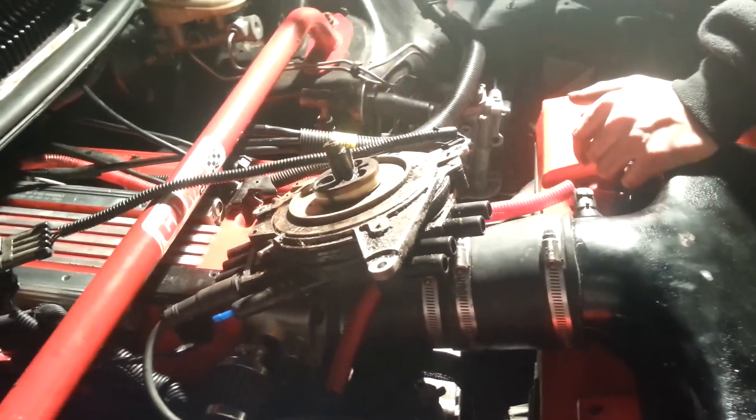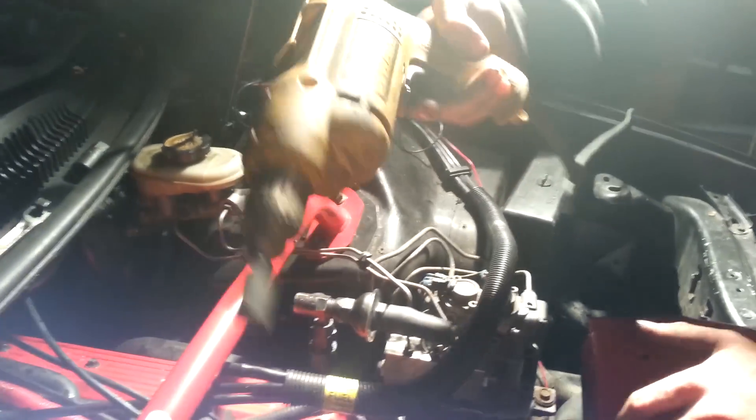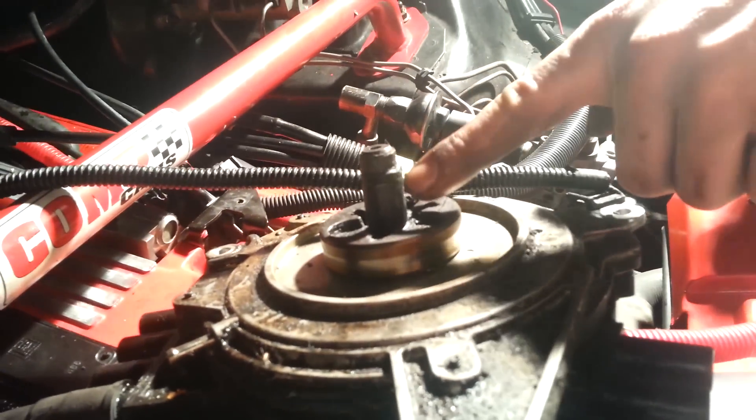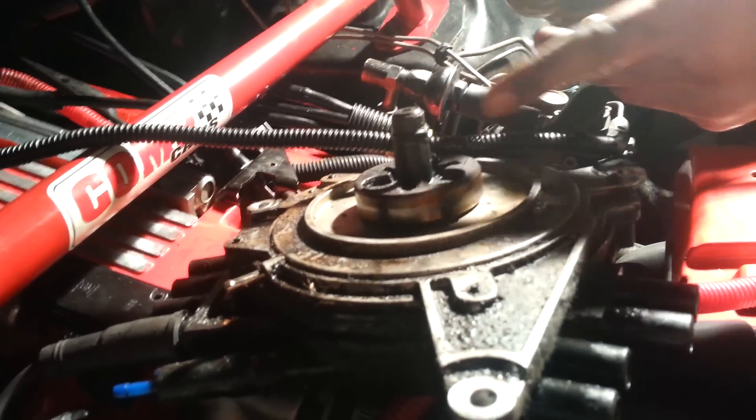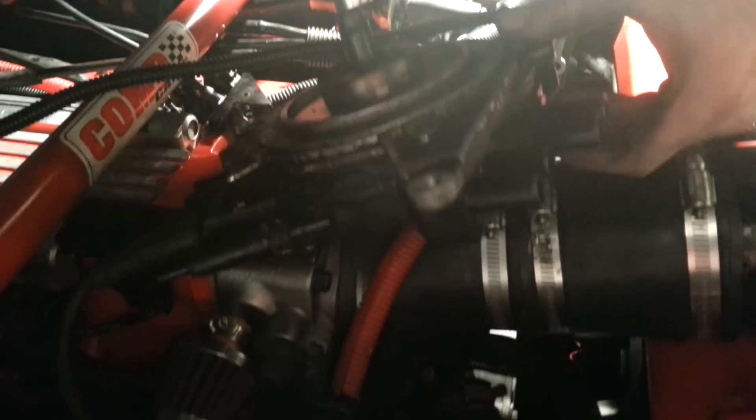This represents an OptiSpark with the key on, engine off, not turning over. I've taken a regular corded DeWalt drill, put a socket on it, and put some gorilla tape on it so the socket fits snug and won't slip or damage the shaft of the OptiSpark. You stick this over here and if you watch the spark plug, you can see it has a nice hot blue and white spark.